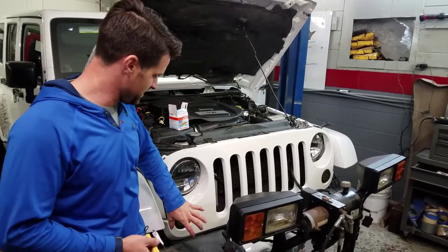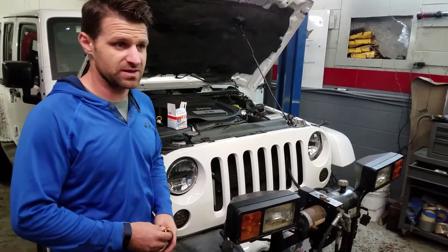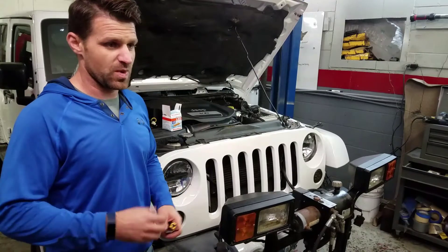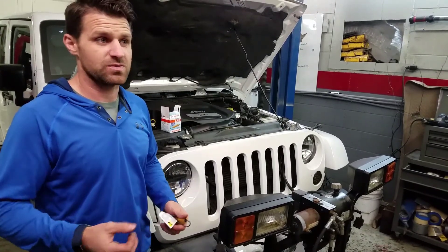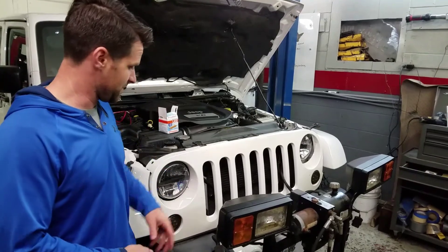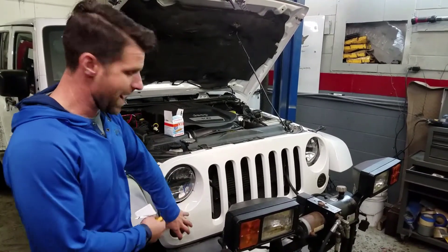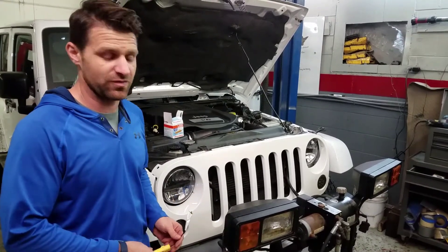The reason is because with LED it uses less current than your vehicle is used to. Just like in your bloodstream, your body is used to pumping a certain amount of blood — if it gets more efficient, still pumping that same amount of blood, it's not going to work correctly. Same thing with your electrical current. It's now sending too much current, or not requiring as much current as it was sending before.